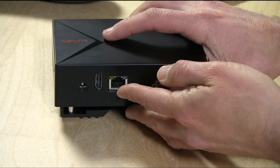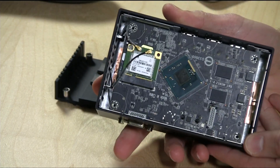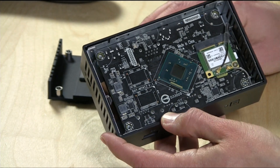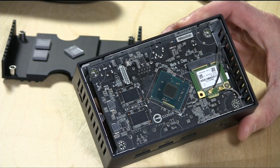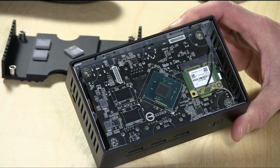The way they differentiate these is that they come pretty much pre-configured. This model comes with four gigabytes of RAM and 64 gigabytes of eMMC storage. You can add an mSATA drive — you have to take the whole thing out, but underneath the motherboard there is an mSATA slot so you can put in another SSD. Now, if you want to run Windows 7, you're going to have to put that mSATA drive in because it won't boot off the eMMC. So if you are a Windows 7 user, you'll have to pay a little bit extra to get that drive.